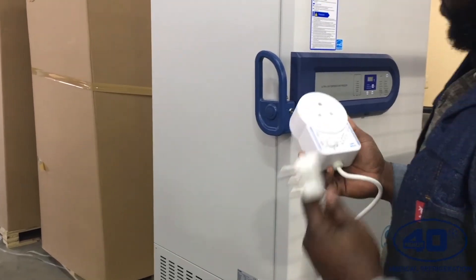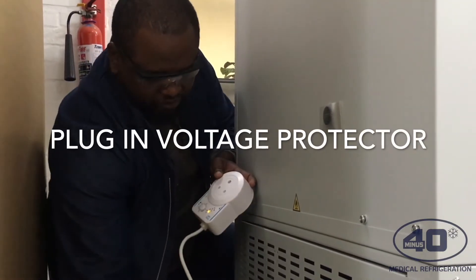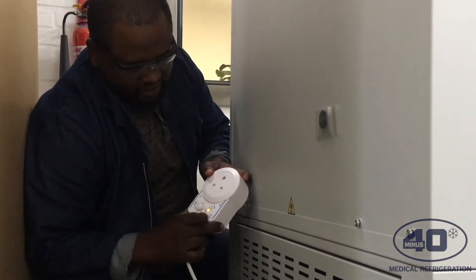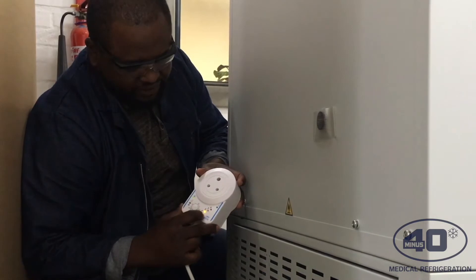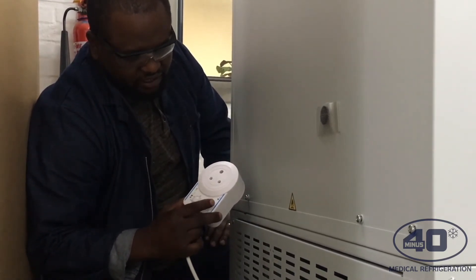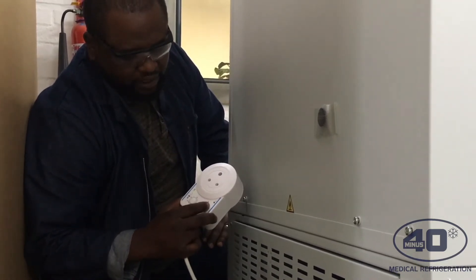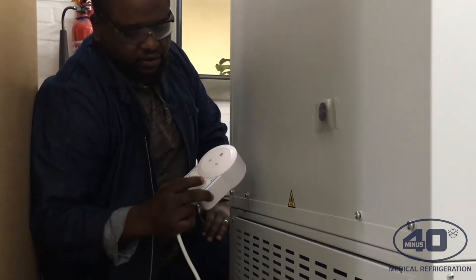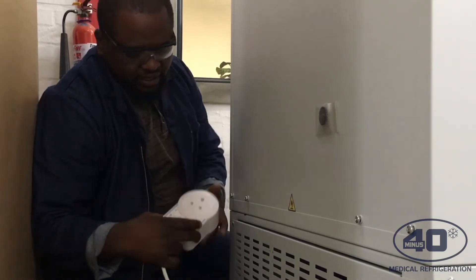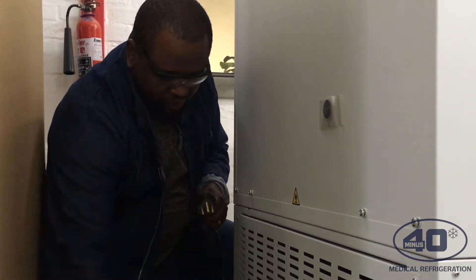You have to plug the voltage regulator directly onto the power socket. I've plugged my voltage protector and now I'm just waiting for the timer delay — it's checking the quality of the voltage supply before showing a green light. As soon as I have a green light, it's safe to plug your freezer. Right now it's green, so I'll plug the freezer in.